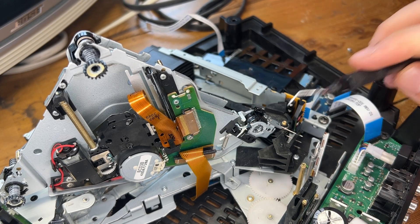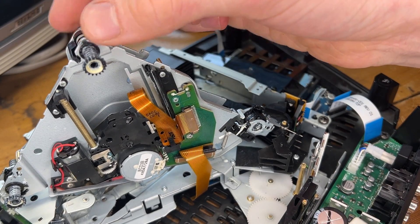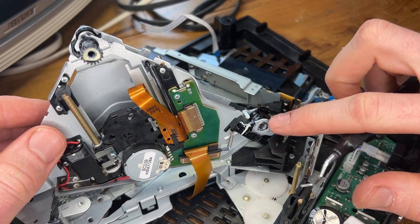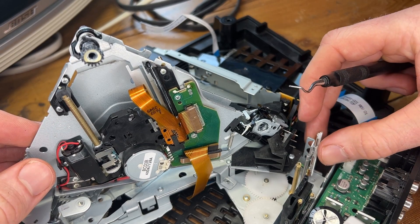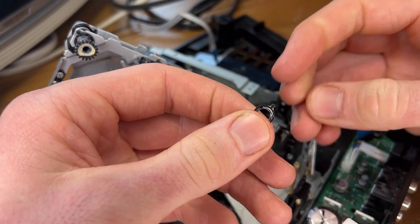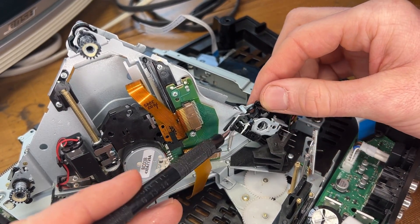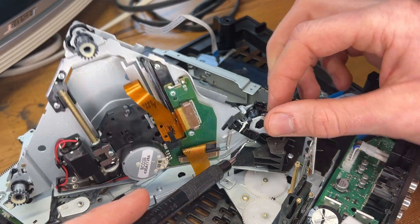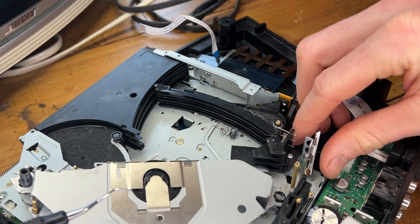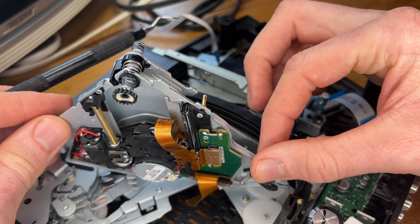So after much trial and error, I think I found the source of our binding. I took this apart a few more times and inspected the bases of these jack screws. The bottom side is the nut that it threads through and the top is free floating. This is the driving screw — the one that has our little potentiometer slider sensor to tell the mechanism where it's at. This one has broken off. The bottom of the carriage has no way of positively locating itself; this top plate will just float around. Right next to that screw is the tab that interfaces with the switch that lets it know where it's at, so it was overextending the carriage up and down — it couldn't exactly know the position of this bottom plate.